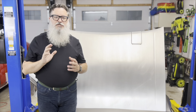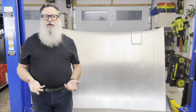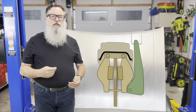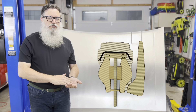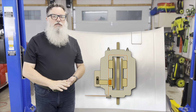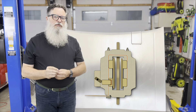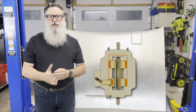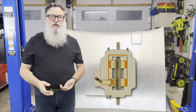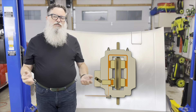The one part I hadn't checked yet was the emergency brake, because I basically never use it in my automatic. The stock DeLorean caliper has a completely separate mechanical e-brake — pulling the lever clamps arms onto the rotor to slow the car. The HighSpec brakes use a hydraulic e-brake. This works by moving a plunger that blocks off the inlet for the brake fluid while also compressing the fluid already in the caliper. The same brake pads used for normal braking are used for the e-brake. Pulling the lever engages the brake, just in a different way.